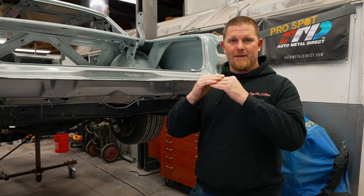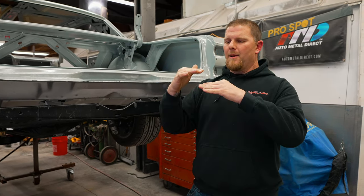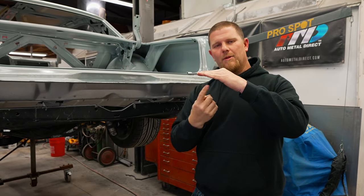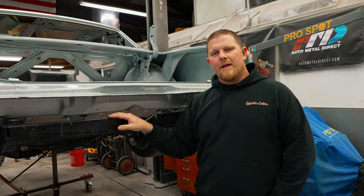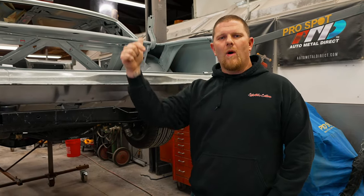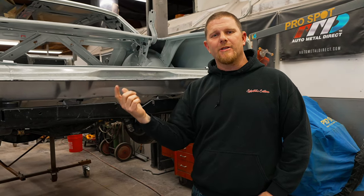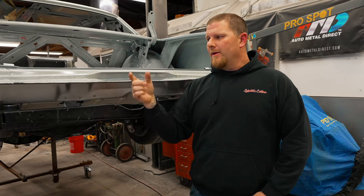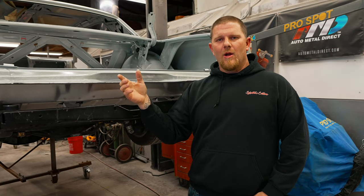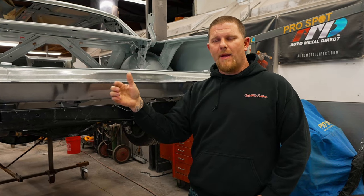Sometimes you do go through both pieces because the metal is very thin from rust, but if you go through both it's going to be a lot more of a challenge to fill that plug weld back up. As Justin worked through the back edge of this panel, we're pre-planning what angle we're going to put the drill and what side we're actually going to drill and leave the hole. We have to take into consideration which panel and whether it's going to fit. Try to think ten steps ahead as you do this panel.